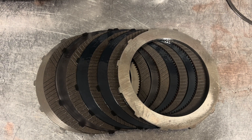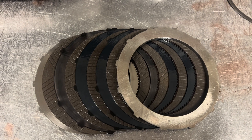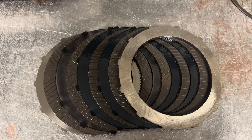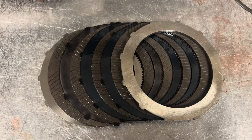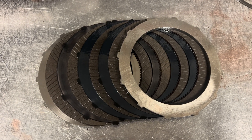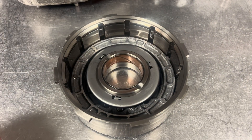These are our forward clutches, applied in forward gears — first, second, third, and fourth — and they release for reverse. As always, these things should look perfect, and they do. I'll go ahead and put a new set in just to be on the safe side even though there's absolutely nothing wrong with this. It's a brand new customer to me, he wants a fresh transmission, and we're going to give him a fresh transmission.